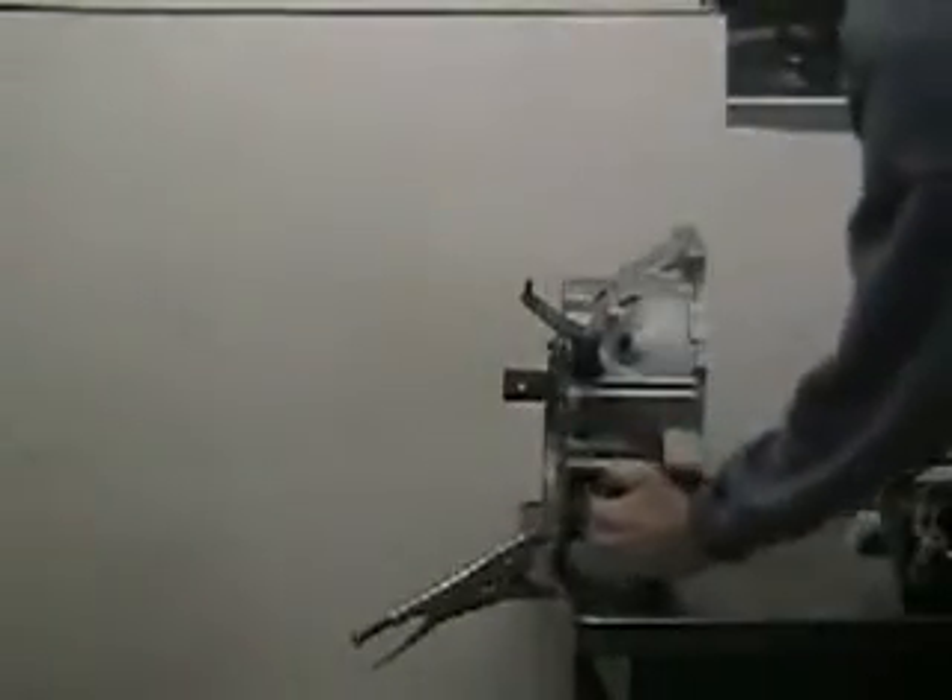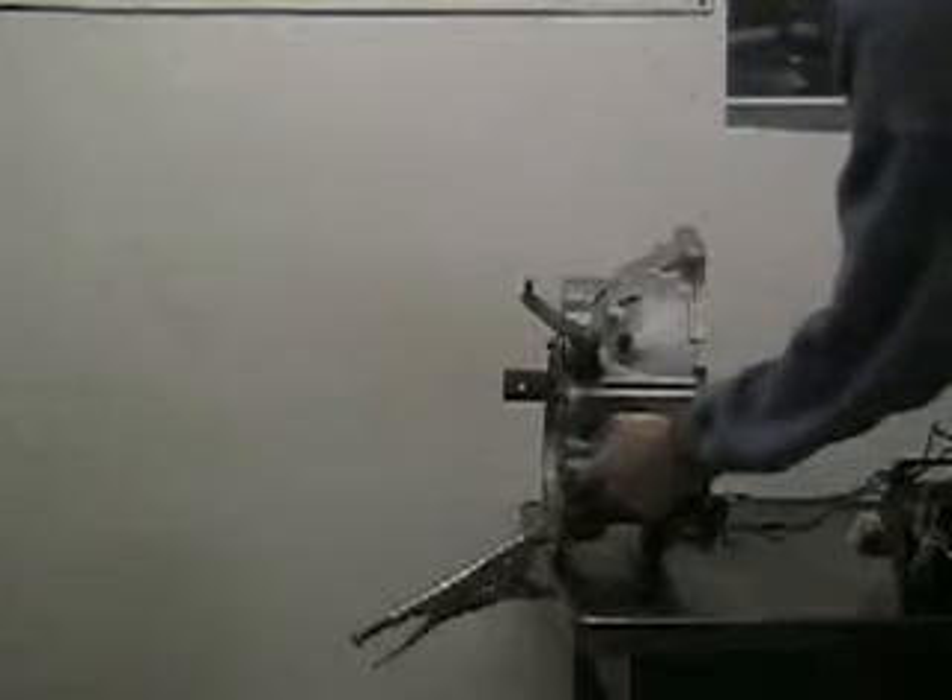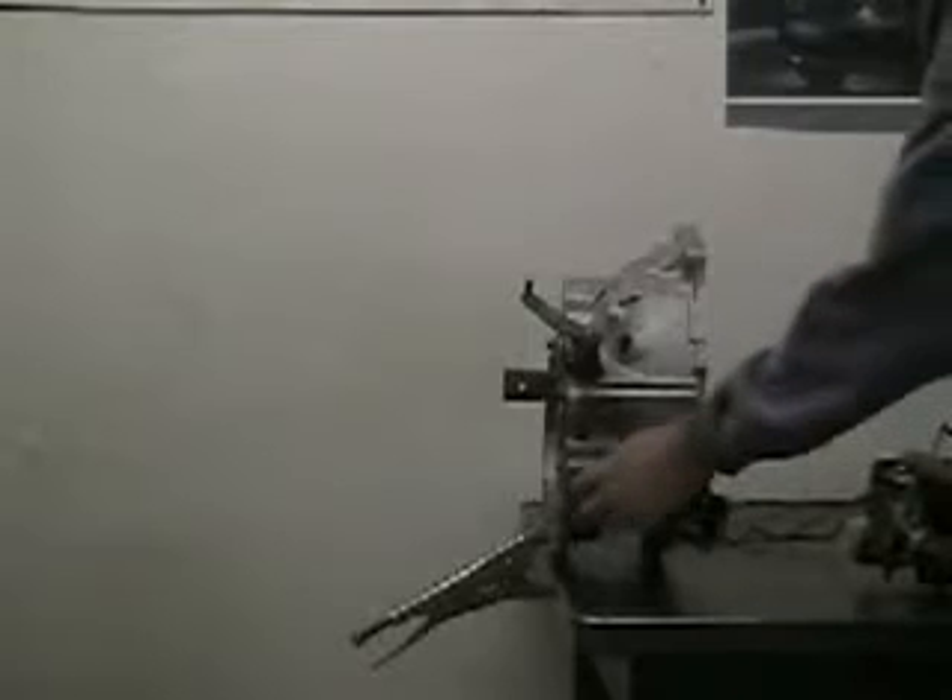I'll show that here — where we have this past the halfway point, it's away from the slave cylinder on this side of the housing. I'll go to push this pedal in, and just before I get all the way to the end, it bottoms down against the bell housing. What happens is I'm pushing this pedal down and this is stopping short, and we're not getting the full travel out of the pressure plate here.